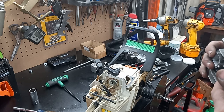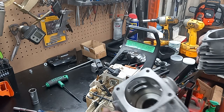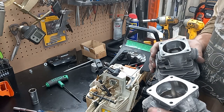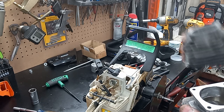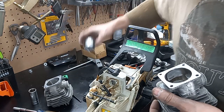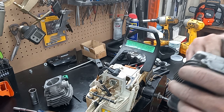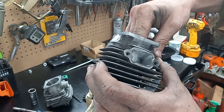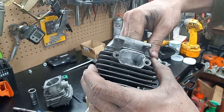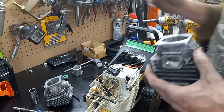I was checking a few things out. I think the exhaust port's a little wider than this one — I probably widened it a little bit. The piston has plenty of clearance. If you do widen your exhaust port, you've got to make sure you've got enough room so you don't run into your crankcase issue.